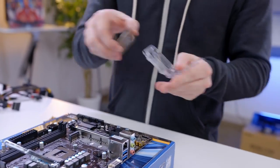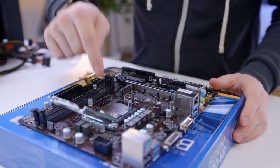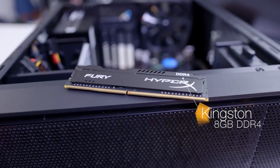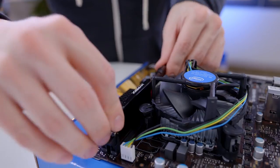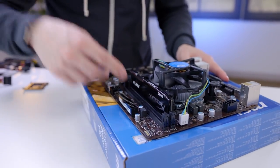This is actually going to be my first time trying the G4560. As a guy who's done just a couple of budget builds, I'm really excited to see what this thing can do, but from everything I've seen, it is no joke as far as performance goes. Next up we have memory, and here we're using 8 gigabytes of HyperX Fury. One of the cool things about Skylake and Kaby Lake chips is that they do support DDR4. While it's not really a huge difference compared to DDR3, it is a little bit quicker, and I'll always take a couple extra frames when I can get them. This gives us 8 gigabytes of RAM, which is fine for now, but if you ever want to upgrade we do have an additional DIMM slot to get this up to 16 gigabytes.